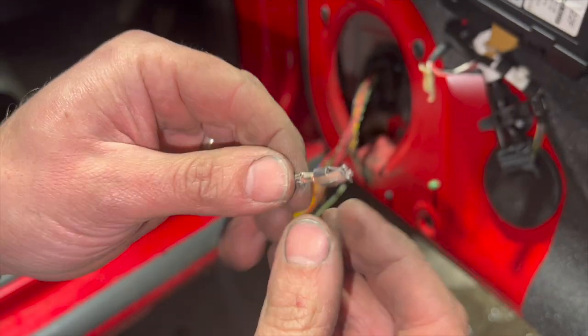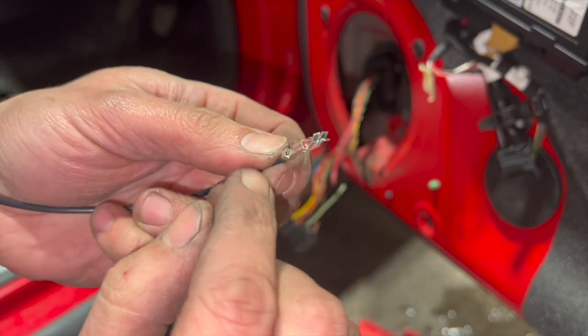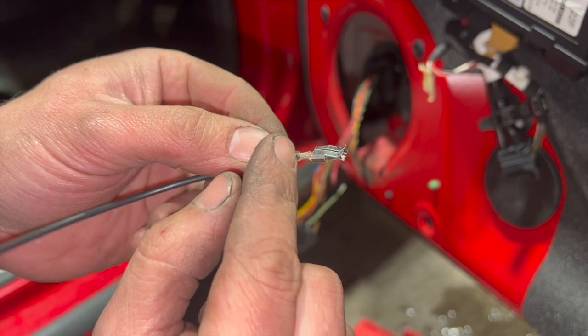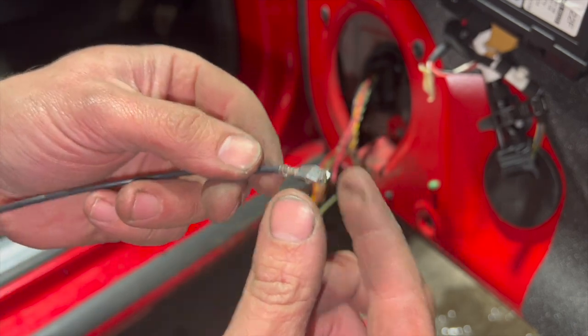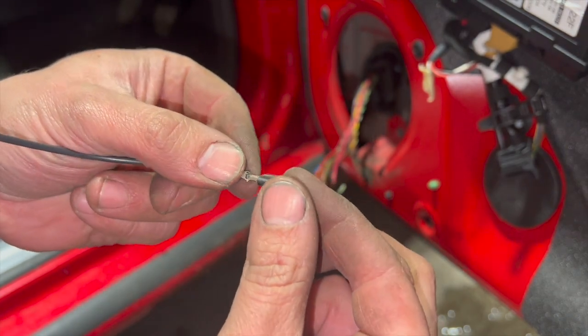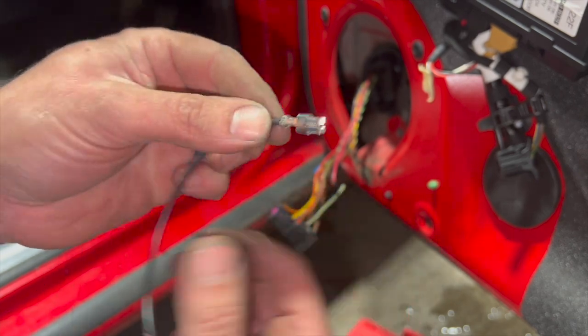Now I've done that with a crimp. You can see you've got a really nice firm crimp on there. I did that with a bigger one to start with. Sometimes you go straight in with the medium sizes, and sometimes that crimps the end up a little bit. If you go with a bigger one, it always curves them nicely to start with, and then give it a final nip with the medium one. So you can see that's got a decent crimp on there.